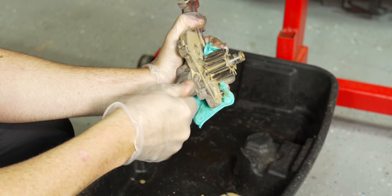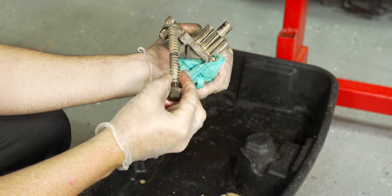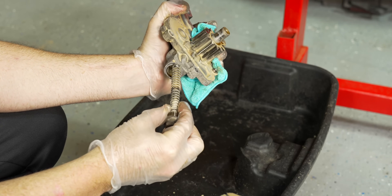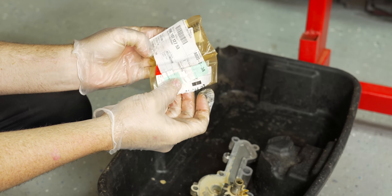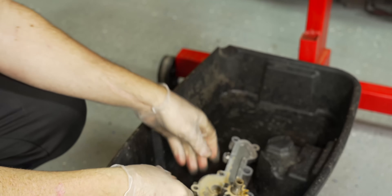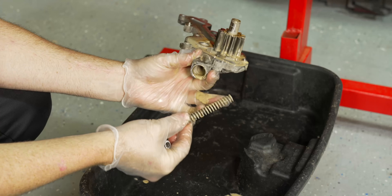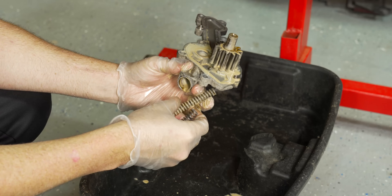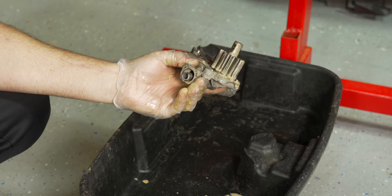The Caymans and everything all have this spring. This spring actually looks pretty good. I actually have a Cayman spring here — let me see if it's exactly the same. I have a brand new one, maybe we should just change this out while we're right here. There is a crush washer on there. These springs will actually get worn out and this will cause a drop in oil pressure, which can lead to bore scoring and all kinds of nasty stuff. The Cayman spring is exactly the same spring — let's just go ahead and change it. They're not expensive. We'll slide that in there and get a new crush washer.